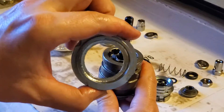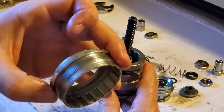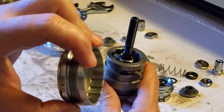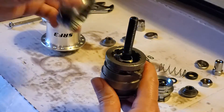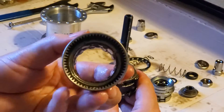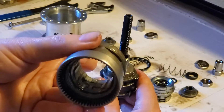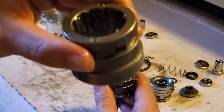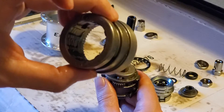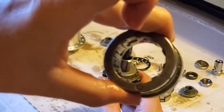The ball ring has four outside prongs and 20 points of engagement on the inside that are actually offset, so this flange is using those pawls since they're deeper on this thing. This particular thing is a ring gear. The ring gear actually has a ratchet inside with 10 points of engagement to engage to that driver. It has a little bit more thickness on the end, and the pawls I'm holding by hand just to keep them from coming apart can just easily fall out because there are no pins holding them in.